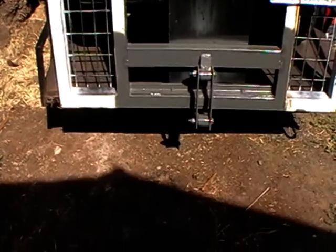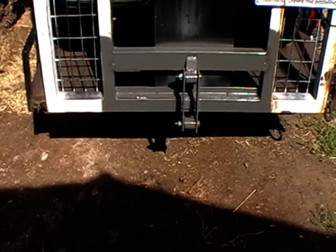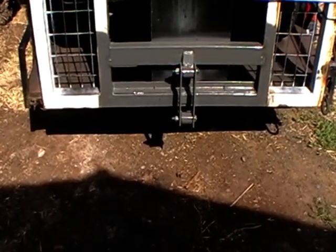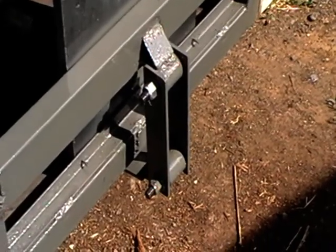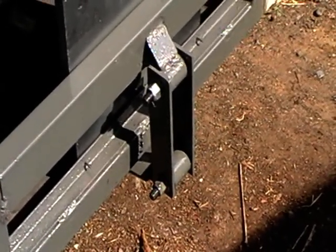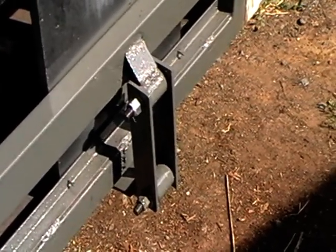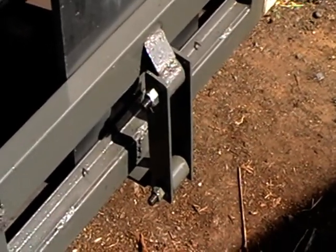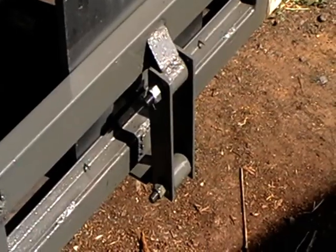I saw a site on the internet that had pictures describing how you could fit a leaf spring off a car to assist with the drop-down and the loading up of the trailer ramps, so that's what I've done. Basically what you do is get one leaf spring — I used a quite heavy duty car one from an Australian vehicle — and you mount a top mount and a pivoting bottom mount with two dropper pivots.